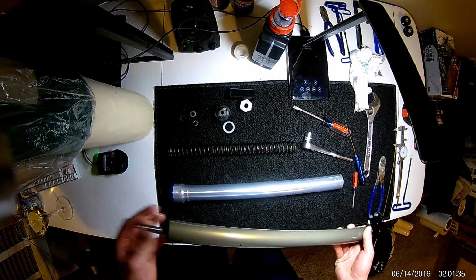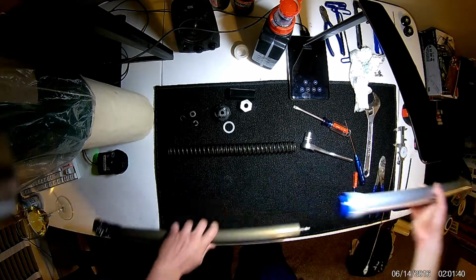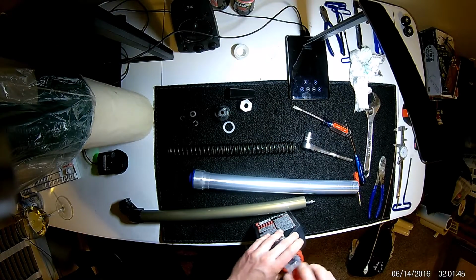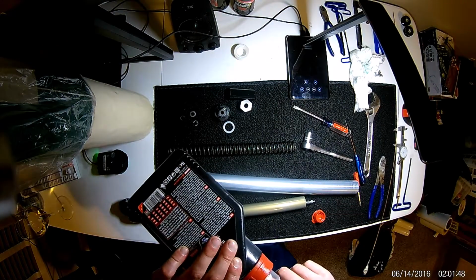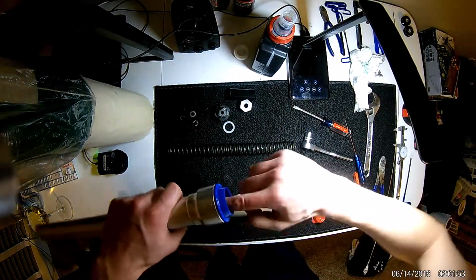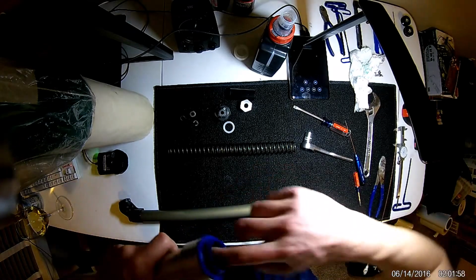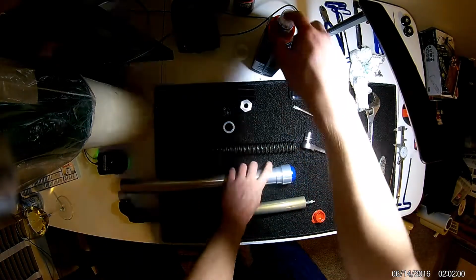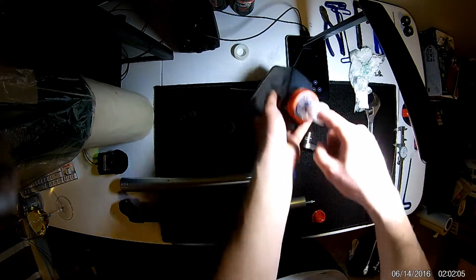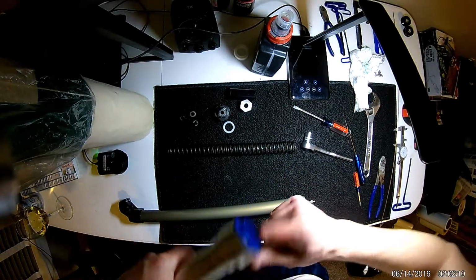Okay, so the cartridge is back into the stanchion. From here, we can slide our tube back over. It's pretty important to add grease or oil on your seals here. This is when you're actually sliding everything together into that O-ring. So be pretty liberal with this, add a good amount of oil all along the inside of that seal there. Again, just so if it hangs up, it doesn't have the tendency to tear through that seal, it will kind of slide and glide right over it.